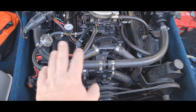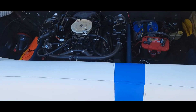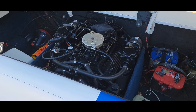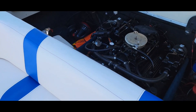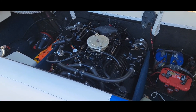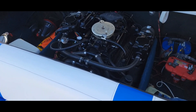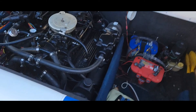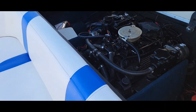I'll get that prettied up later, or figure out whatever I'm gonna do. If I need to replace the pump - even though that is a new Carter unit - it's just putting out too much. I thought seven PSI was the max and it's pumping out over nine. So I don't know if I want to leave the regulator in line or just get the right pump, a new pump that's not acting up. Even though that was a marine unit for the Mercruiser 350.